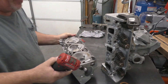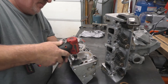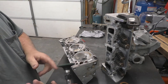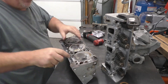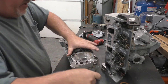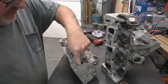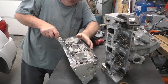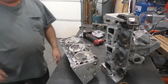This one here I already know is not going to work — it's already starting to load up. Keep that in mind and try to scrape a little bit more first. When the pad is gliding over the graphite but not gliding over this, that will remove material off of it if you're not careful. We're going to keep scraping here to get that clean.